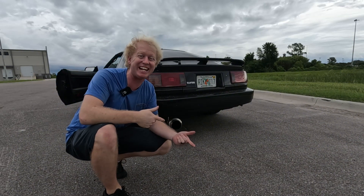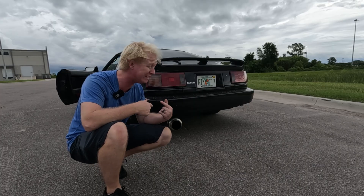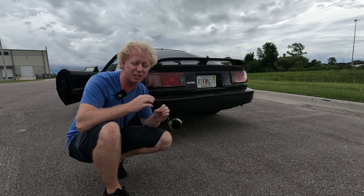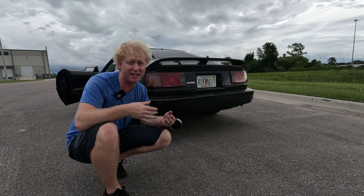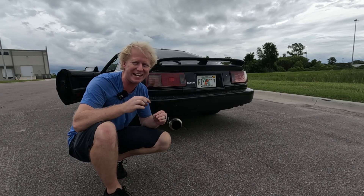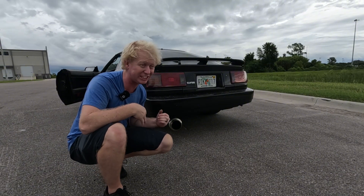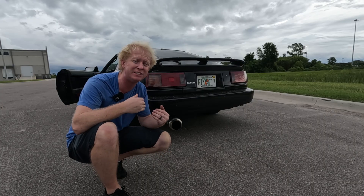Checking the log — we're actually building 8 to 12 psi of boost. The wastegate is opening up and this thing is ripping right now — a little bit more boost than I had anticipated. But honestly it's not as aggressive as I expected, so we'll need some fine tweaking. Let's shut this car off, let it cool off for a second, and we'll probably get right back to it.